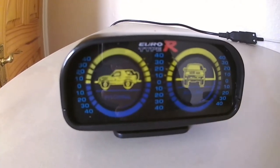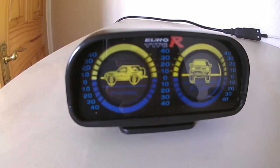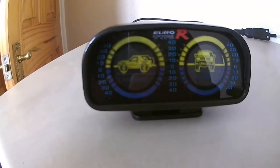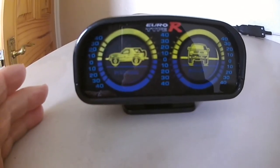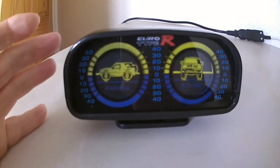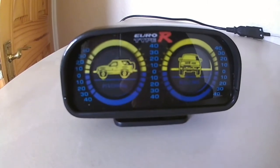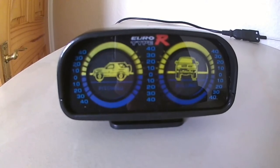They are backlit. This one arrived today and first of all it didn't give the correct reading front to back or left to right. I know it's got an adjustable base but you really need to calibrate these to where you're mounting it in the vehicle. Now you can calibrate them to a certain extent, but there's no adjustment knobs anywhere — you simply have to take the mechanism apart, separate the gears from the weights, and then readjust it, which is what I've done here, and it's not easy because they're little mini circlips that hold it all together.